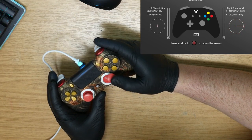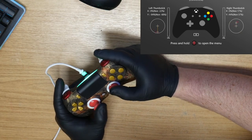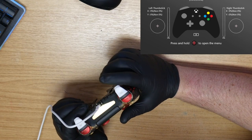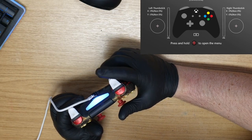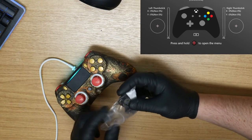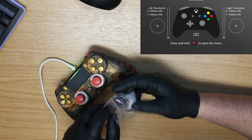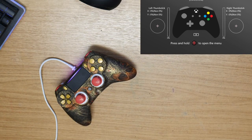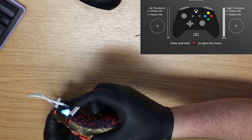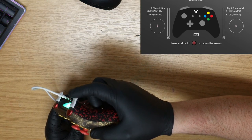If that one's going, this one isn't far off, even if it's not presenting any issues. After 10–15 minutes of gameplay — Call of Duty or something — it could start acting up. Let's check the other buttons. Right trigger here isn't going to 100%. I'll just try something first. As you can see, that's fully pressed down — we're getting 100% now but I'm not happy, we were definitely getting less.